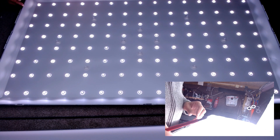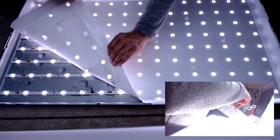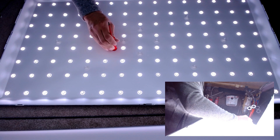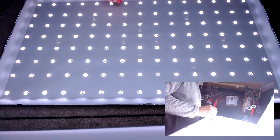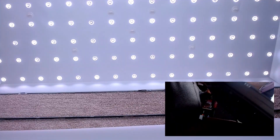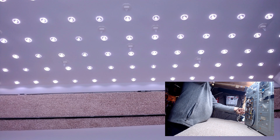There is also a connection in the middle-right. I wasn't sure there was one on these, but let's pull the top one back — yeah, there it is. The backlights are working flat out at the moment because we haven't got the main board in. Let's try the power board end and see if there's a loose connection there.